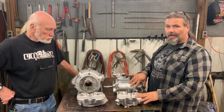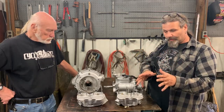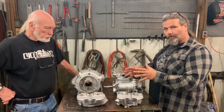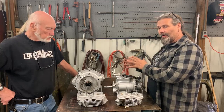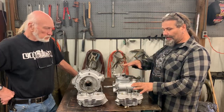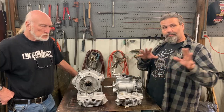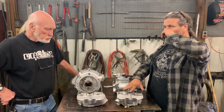With that in mind, we're using a fine media and we want this to be the last step. So we want to go from the traditional soap and water and degreaser, over to the parts wash tank, wash it again, take it into the bead blast cabinet, bead blast it down until you get to this finish, then soap and water again, and bring it over to the vapor blasting cabinet for our finished product.